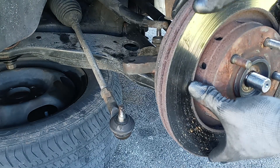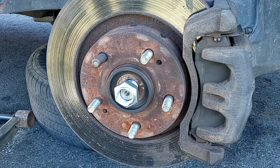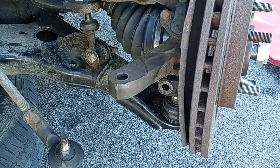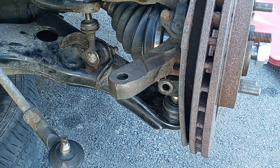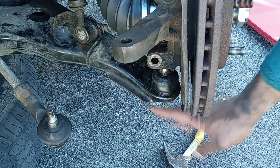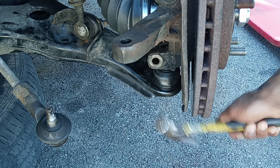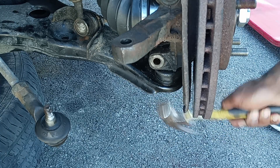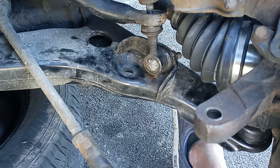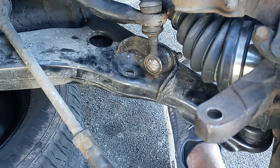Push this all the way in and knock it in. Put on your new screw but don't tighten it just yet. Remember to put back the lower control arm — make sure you put back those screws you took out. For the control arm, you want to knock it because of the tension, knock it all the way up until it goes up. Remember your sway bar link — you want to screw this back on.